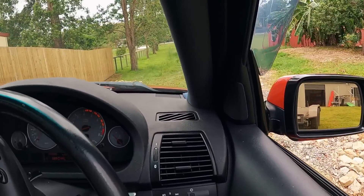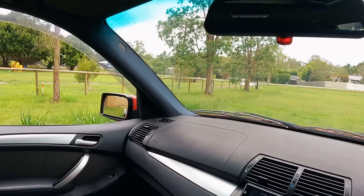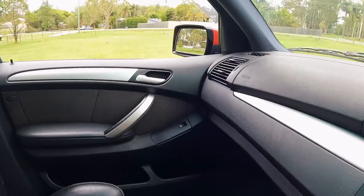Trailer's rattling along. We've had super heavy rain this week and I wonder if it's moisture that's got in and killed that light control module. These are also prone to having sunroofs blocking up, and with the amount of pollen that falls out of the trees here they could be blocked. So that's something else we need to check, just in case we end up killing this module as well.